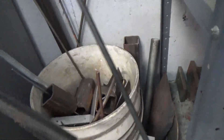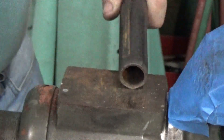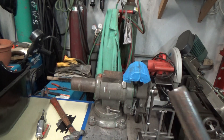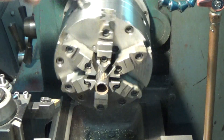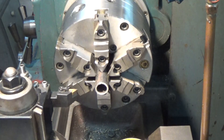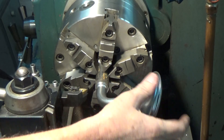This piece of pipe is too big. Now that might work — let's go see how close it is. It's just a little bit loose, so I think I can hammer that end down a little bit to make it tighter. Looking good. So I'm going to set it up in the lathe and trim that front off just to make a good square end. Right now the oil pump pickup won't fit into that hole because I've closed the end up some, so I'm going to keep machining the end off until it fits. There we go — perfect.